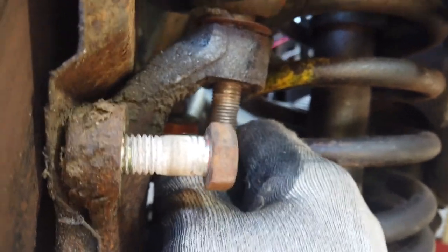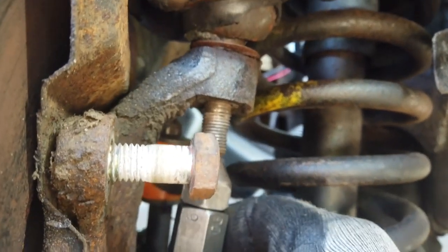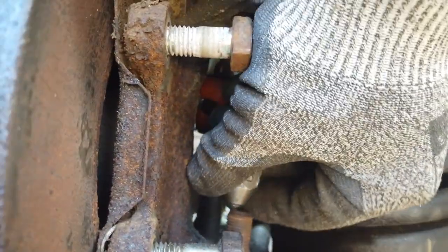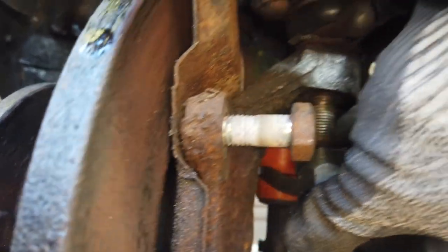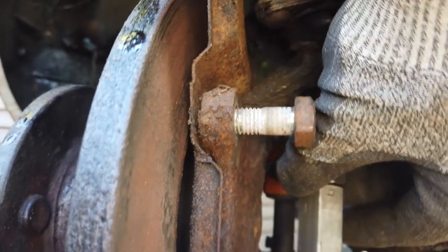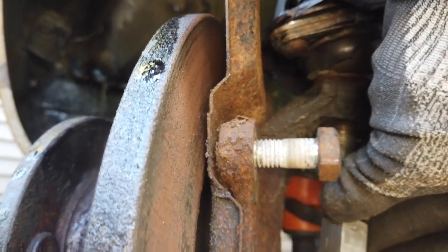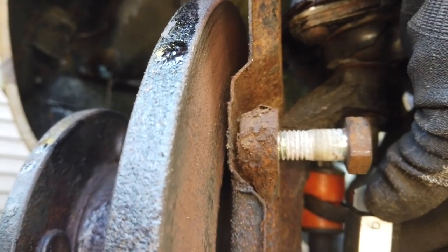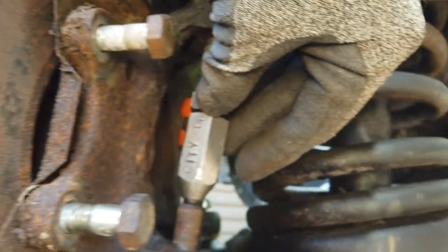We offer it between, incoming, expand it out. Once it goes between the nipples of these ball joints - a little bit of dirt in them stopping the ball engaging, but it will go. This will push apart both at the same time so it'll split your uppers and lowers. Always replace your upper and lowers in pairs, both sides - so you're going to do this, it's all four to go. That's upper ball joint and lower ball joint all together.